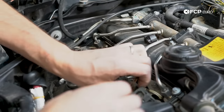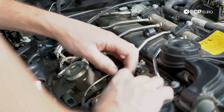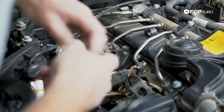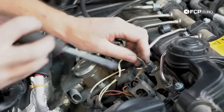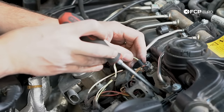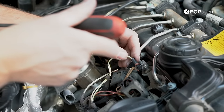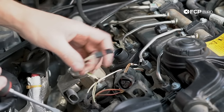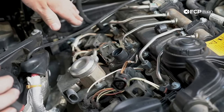Coil pack — traditional flip up and unplug. For the injector there is a small tab that needs to be moved over. You need to pry this tab — facing about seven o'clock if you're looking at it — away, and you can get the injector out. So you can see: injector, coil pack, and ground. We're going to go right down the line doing the exact same thing on all of these.